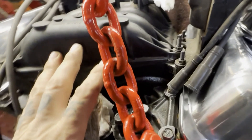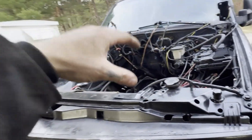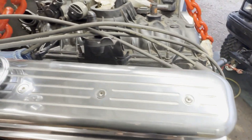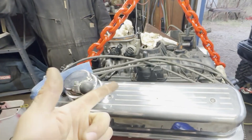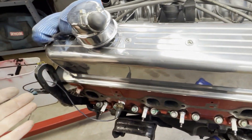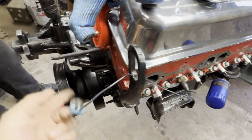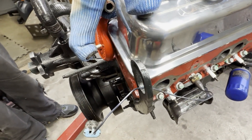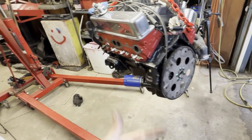I'm not going to put the distributor in yet because I don't want to break it. Sometimes when you put it in there it can hit the firewall and you crack that plastic - pretty easy to do. I try to keep it live and real for you folks. My number one - I got her sitting on number one. Had the young fella put his finger on number one before we put the plugs in, ran it around, made sure we were still right on number one - Top Dead Center. So we should be able to slap the starter on, hook the wires on, get some fuel going to her. And obviously hook up the water and coolant, oil - the important stuff.